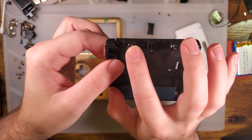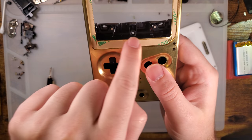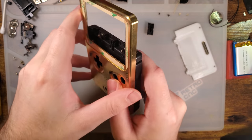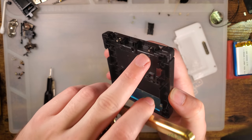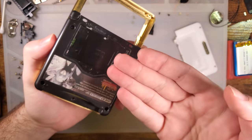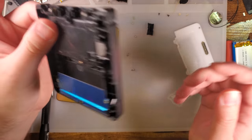The purpose of the shorter dowel pins is because otherwise, if we look at where that's positioned, you might see it'll run into the screen and it could cause spots depending on the specific length. Tolerances are real close, so I'd recommend using the shorter ones, and I'd recommend gluing them, because otherwise, if you have the shorter ones in place, they could drop out and it'll ruin the shoulder button feel.